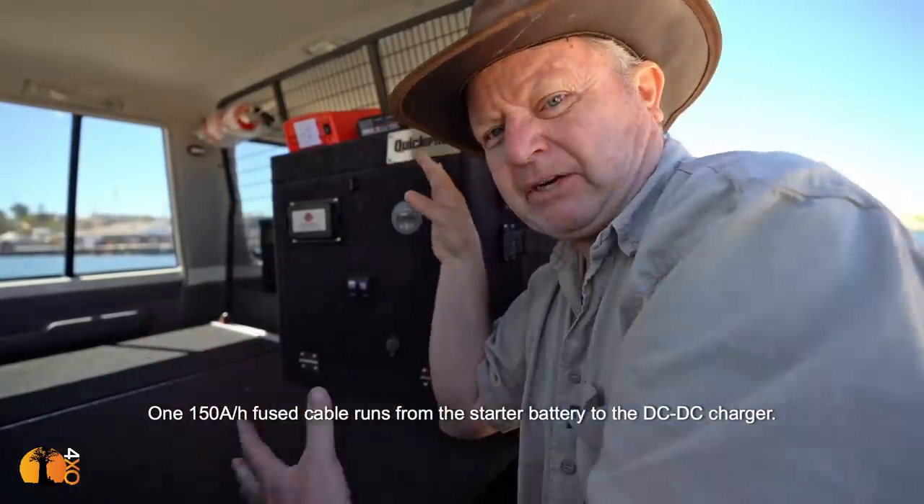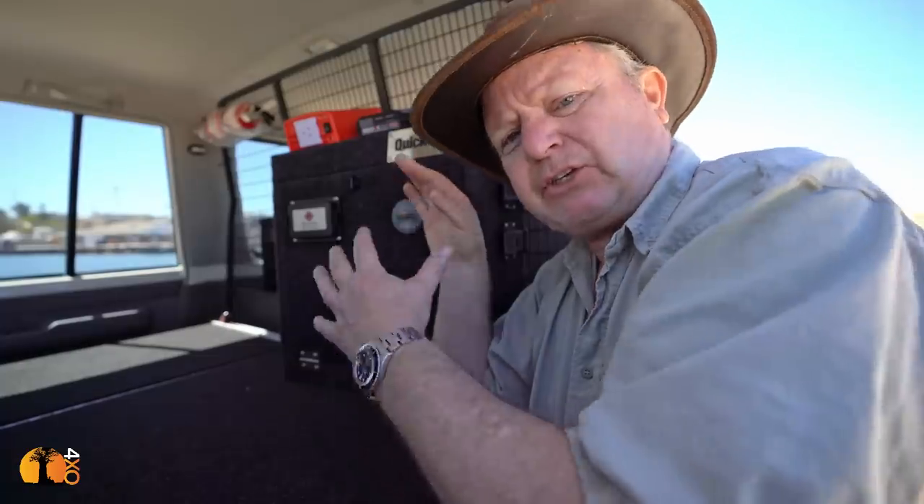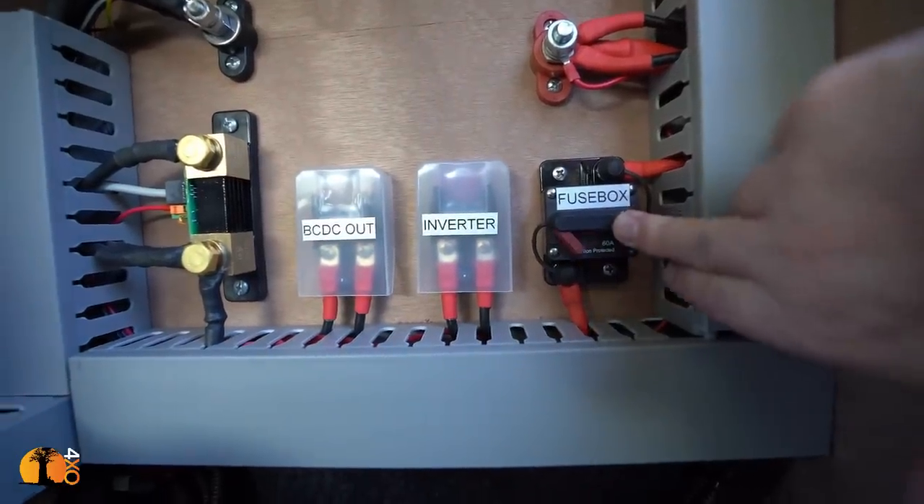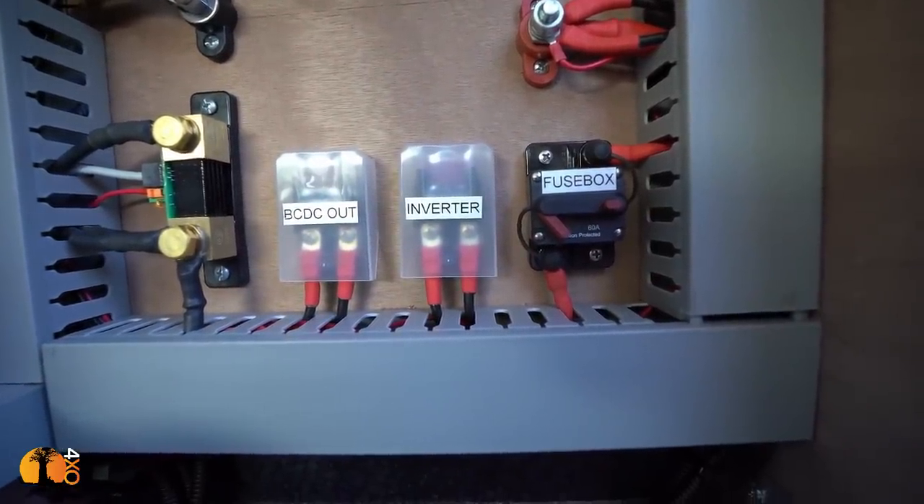The part of the battery system that runs the camping side of the vehicle is autonomous — when we turn it off it's completely isolated. It's a good idea, if you're parking up a vehicle for a long period of time, to put a maintenance charger onto the main battery. I'm talking about a specific battery charger designed for maintenance, not an ordinary battery charger — even a trickle charger could eventually damage the vehicle battery by overcharging it over a long period of time. So the selection of the charger when the vehicle is sitting is very important.